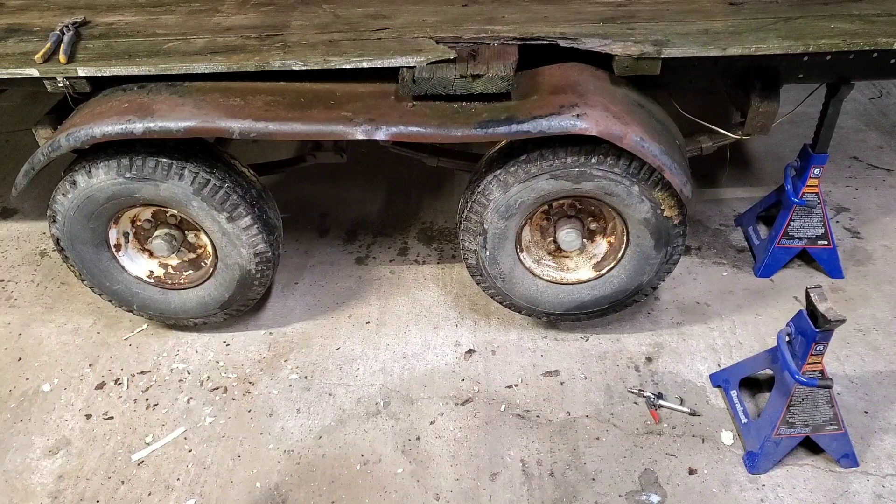I'll be back in about two hours. When we get back we're going to check and make sure both tires are still holding 40 PSI. Then like I said we're probably going to pull off the tires, get to the hubs, take the caps off and see how the bearings are. Regardless of condition — if they're bad we'll replace the bearings; if they're in decent shape we'll just repack the grease and go from there. We'll see y'all in a couple hours.